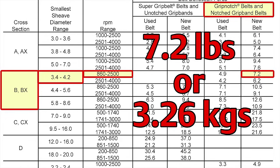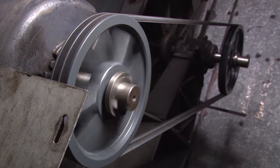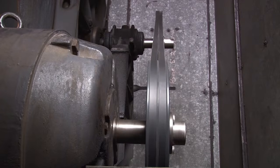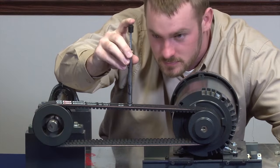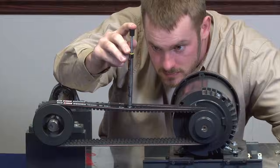Please keep in mind that tension is always changing as the drive runs, as the belt seats, and as the belts wear into the groove of the sheave, you are going to see tension change. In an optimum situation, we would recommend to re-tension after 20 minutes, 24 hours, and again after 48 hours.